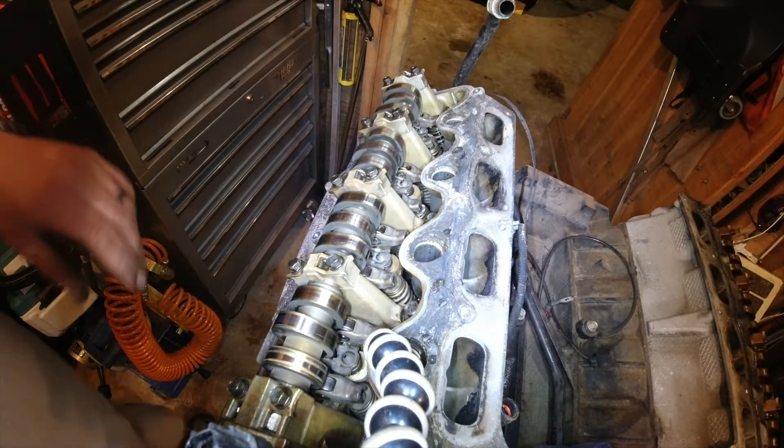We're going to let our plug sit overnight. Something else we want to take a quick look at is our injector pattern in the intake. On a lot of vehicles that are not direct injection — as is the case with most older vehicles — you can get a feel for how the injector pattern is spraying, whether there might be a reduction in dosage or a reduction in atomization of the fuel, by looking at the wash-down patterns from the injectors.